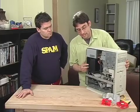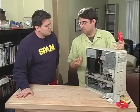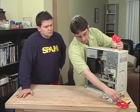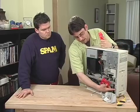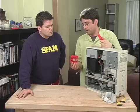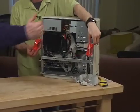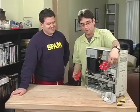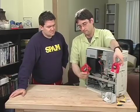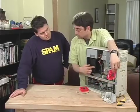Before we even get into cables, I want to talk about cooling fans. What you want is air to come through your machine on one side of the case and exit on the other side. You can do that if you've got a space to mount a fan — this one doesn't have a great space, but I think in the back there may be space to mount another cooling fan. So you want to put one on the front and one on the back, and orient them in the right direction. You don't want them both blowing in or both blowing out, because then they'll be fighting each other.